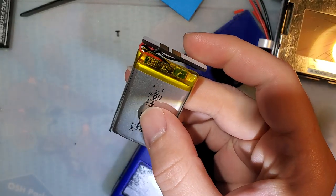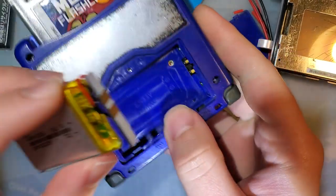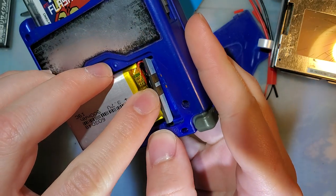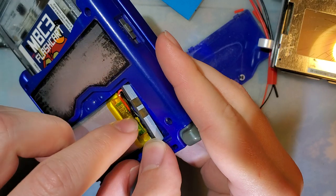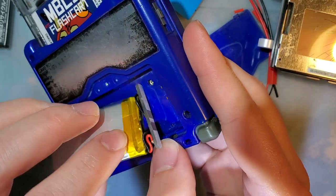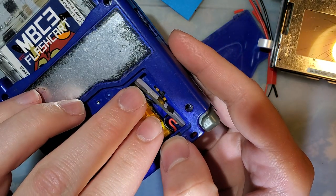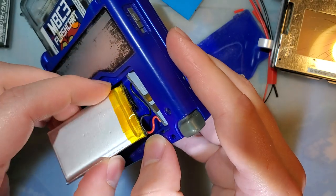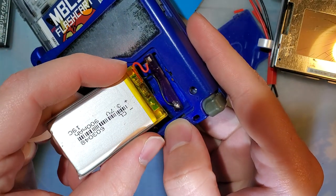So I designed this PCB to interface directly with, I don't know, whatever you call those, the contacts from the SP. I made this board so that if it were installed back upside down, it won't make contact. It'll only hit one of the prongs. Or if it's installed backwards, nothing will make contact here.